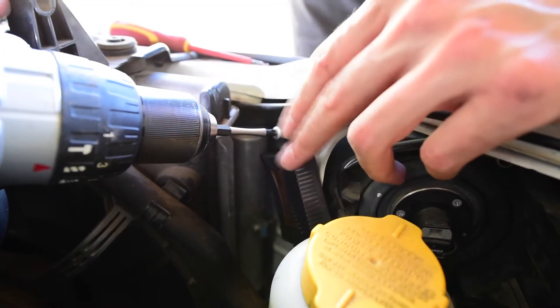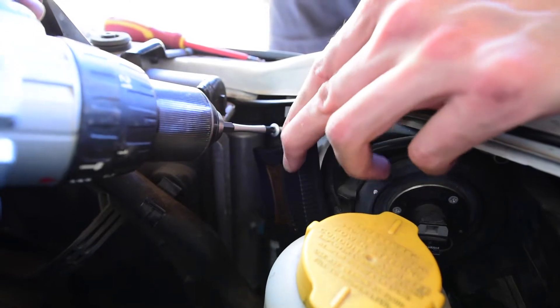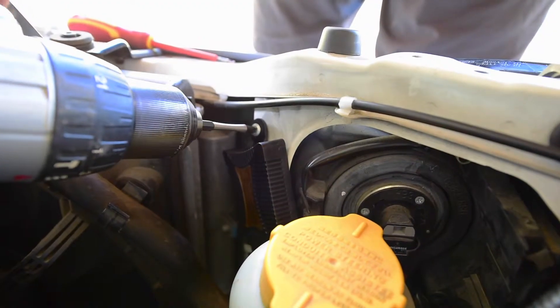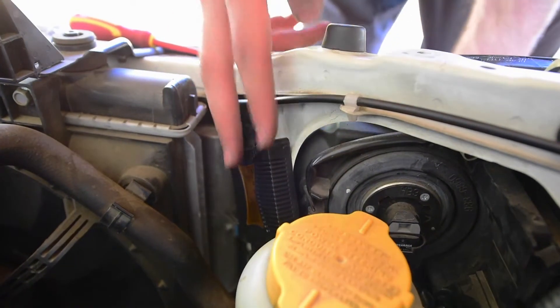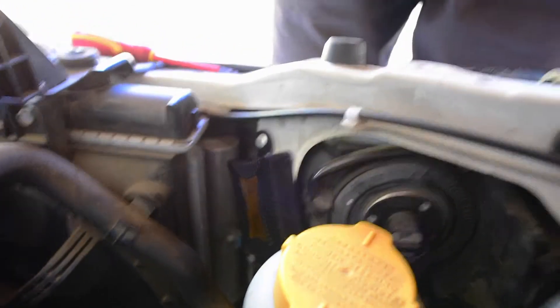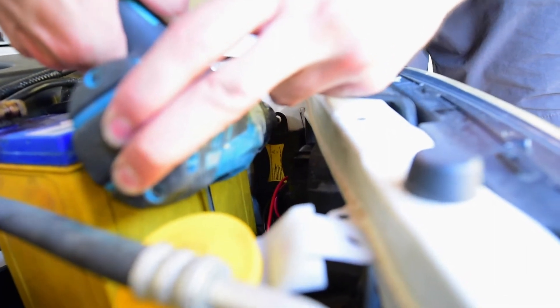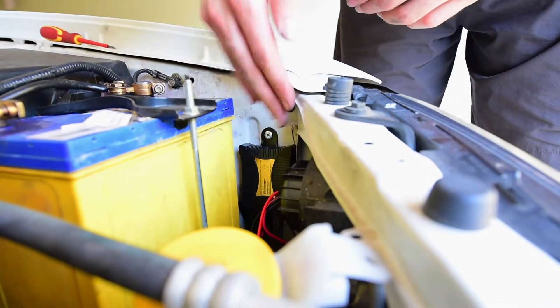We've found a spot for the ballast on this side of the headlight. The cable's a bit tight so it won't sit perfectly straight, but it's not really a big issue under here. I'm just using a self-tapper screw to screw it in — not too tight, otherwise you risk breaking the bracket. And then we have one HID ballast installed. On this side we've already installed the HID and the headlight globe much like the driver's side, and we've got the ballast sitting here ready to be installed — now we've got the ballast installed quite nicely here.